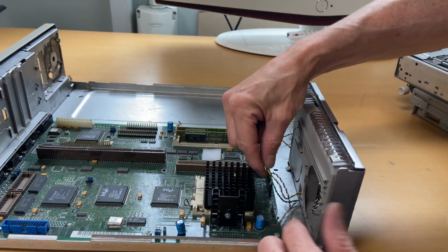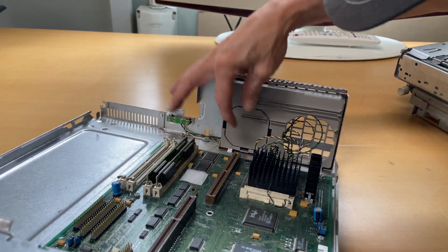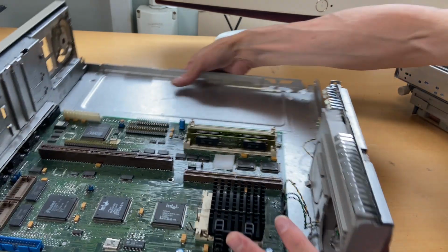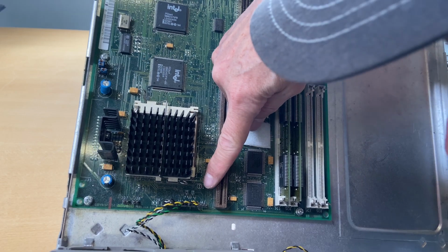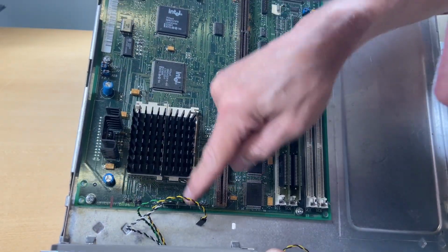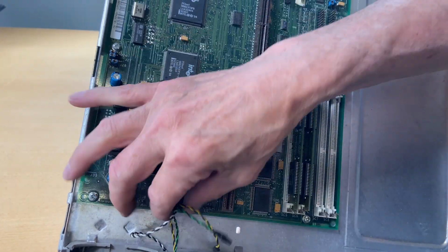And some wires going, I'm assuming, for some LEDs and a loudspeaker. Let me just see. There's probably a loudspeaker behind this thing here. So let's just remove these. So the first one up here, let me show you. So that's an empty one, J43, not populated. J42 is yellow, having yellow that way. J41 is green, having green that way. And J40, which is the last one, is white, having white that way.